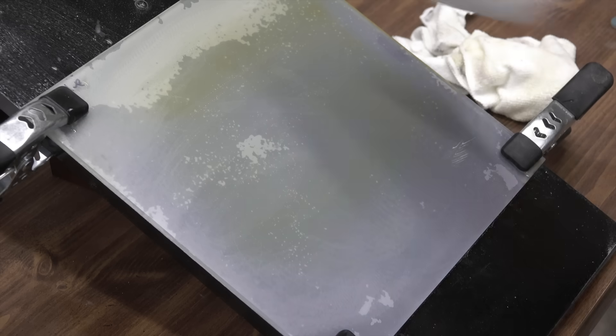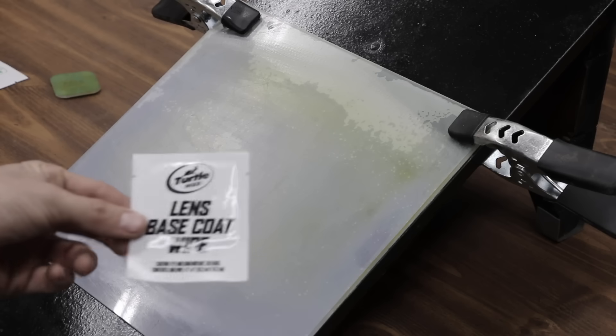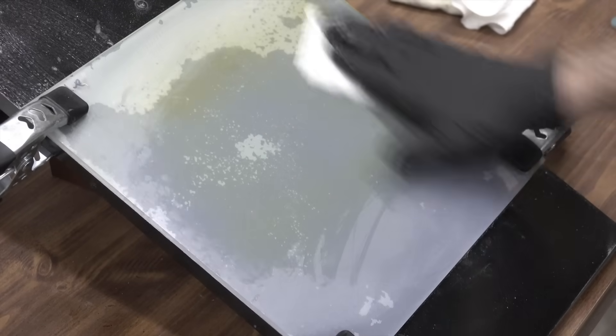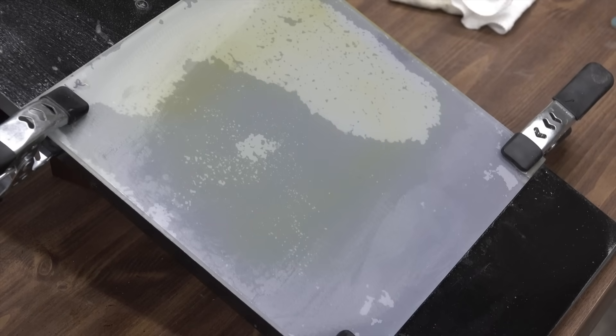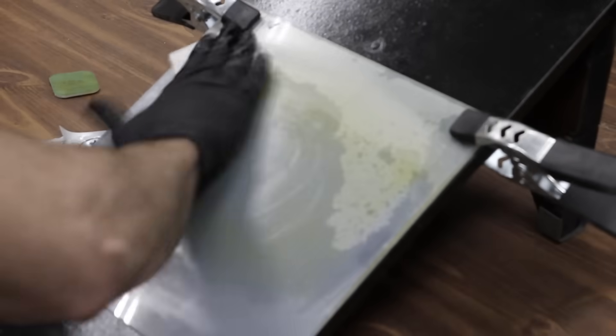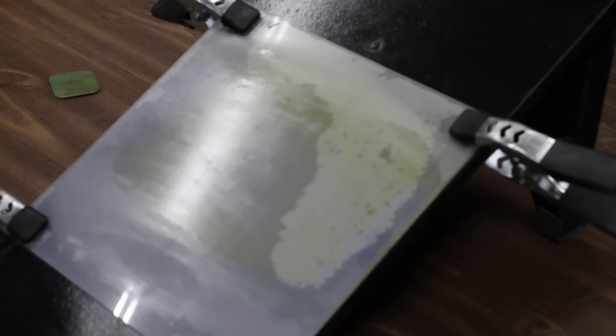Lens clarifying compound can be applied by machine with a foam pad at 1500 RPM. Open the pouch containing the lens coat wipe and, using a plastic glove included in the kit, quickly coat both lenses with the wipe. Once dry, immediately follow with the lens sealing wipe, which helps prevent future yellowing. The coating will cure within 24 hours; however, the vehicle can be driven immediately after application.